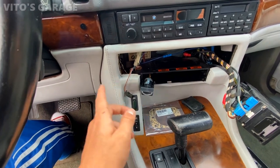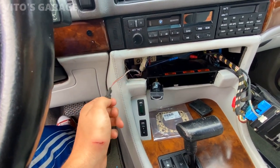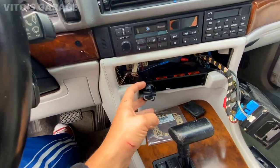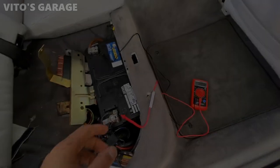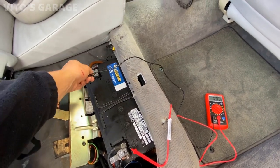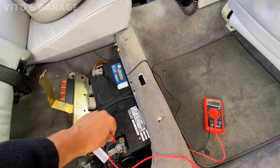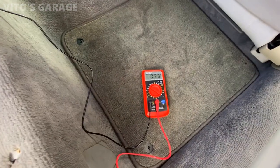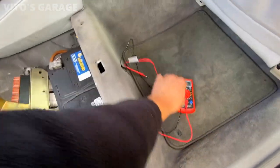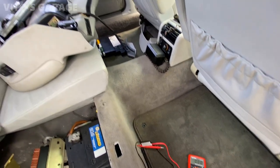We're going to try to see if the charger is working and other stuff we plug into this. I don't know what this other wire is — it was just taped up, probably for something else. We were mainly worried about the radio and the cigarette lighter, and now I can start putting everything back together. The battery was charged up — it had about 12.5 volts when I left yesterday. However, today the battery is low again at about 10.5 volts, so it's discharged again. I disconnected those two modules, but that still did not help — there's still another drain somewhere.